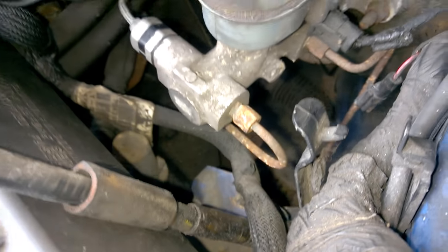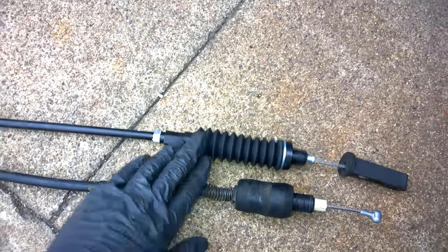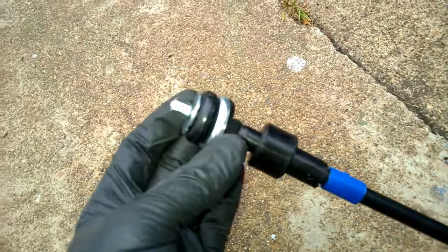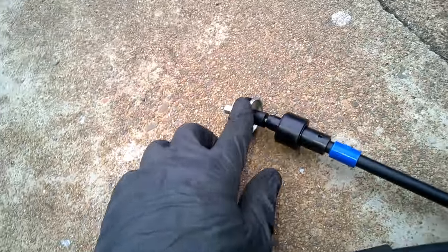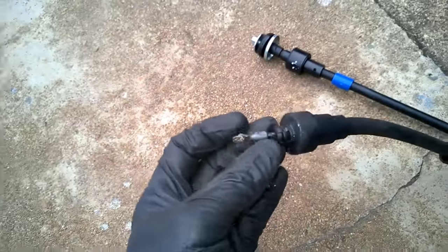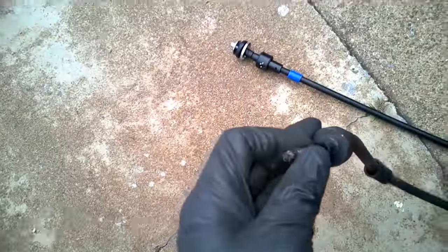Now we can see the end of the other cable — we're going to remove the old one and route the new one through carefully. Right now what I'm doing — and this is for any car, not just the Neon — I'm checking to see where this thing is routed, what wires it's going under, so that when I put it back in I don't have any problem. These cars are so crammed in — you have to get the spacing exactly right, otherwise you'll have a nightmare job. The cable's out, the old one, and I've got the new one here. I'm doing a quick comparison of the lengths, making sure everything's good. You can see the black upstop bracket has its own cylindrical end installed from the cable. Also notice — this is what snapped off on the old one — that disc with the rubber grommet and then another disc. Those hook into that fork, and that stuff snapped off, so it's sitting at the bottom of the clutch somewhere. You can see that's what snapped off on the old cable, and you can understand why that would be a problem.